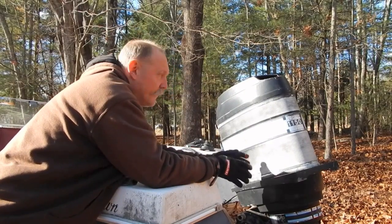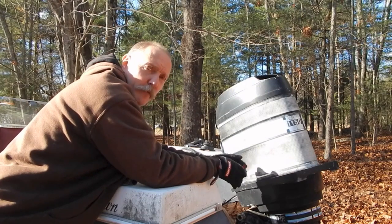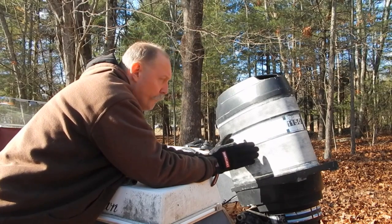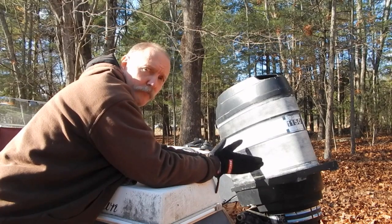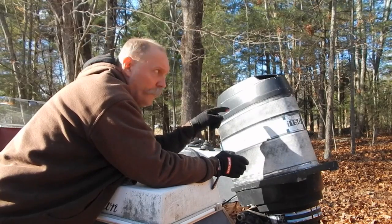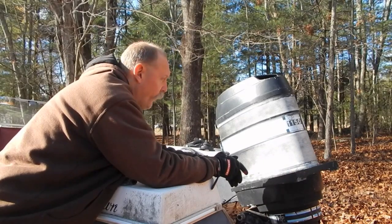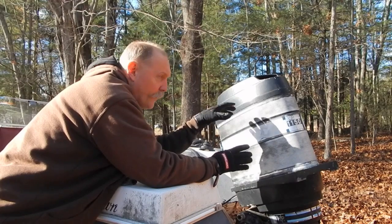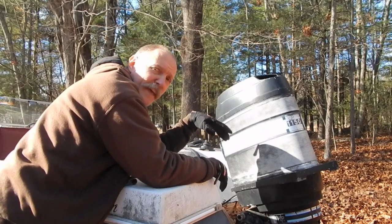Way back when this motor was originally manufactured, and this series came out back in, I don't know when it actually came out, this is a 72, we figured that out. Early on in production, Mercury had a special tachometer, I guess, made for them or sourced, that actually ran off of the pulses that come out of that terminal in the switch box. So if you have one of those old style tachometers and hook it up to the alternator connection, I don't think it'll work, and maybe it even damages the tach. I have no idea.